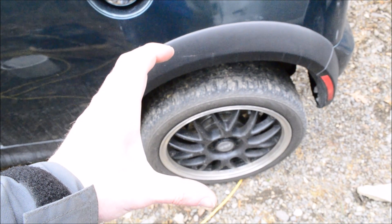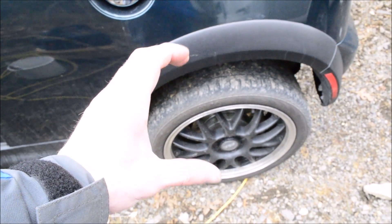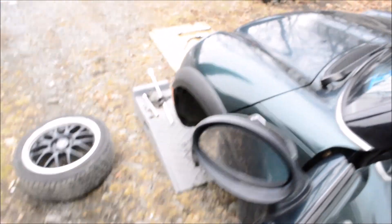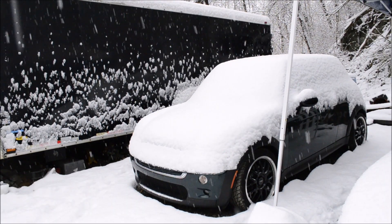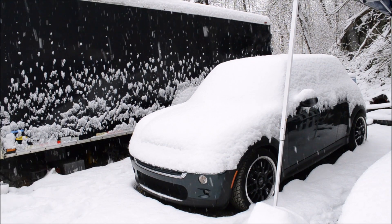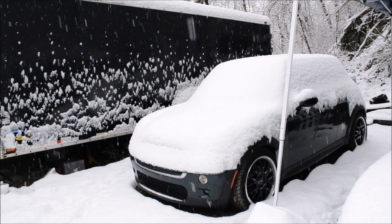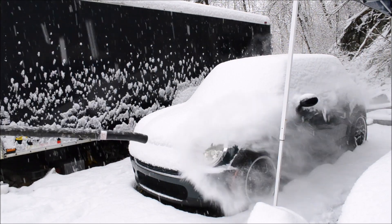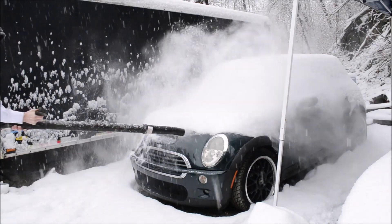It will say, okay, this tire is moving at a different speed than the other tires — something's going on with this one. So I figured I'd have to change that sensor or check the wiring for damage. Turns out the ride-level height sensor on the front left control arm was unplugged. There was some debris in the plug preventing it from plugging in all the way. So I cleaned the debris out and plugged it back in, and now all those codes are gone.